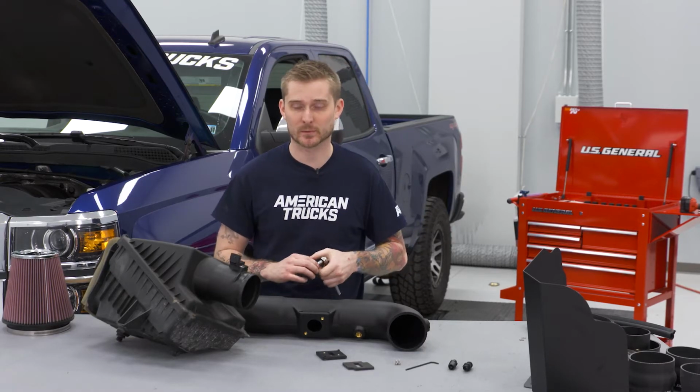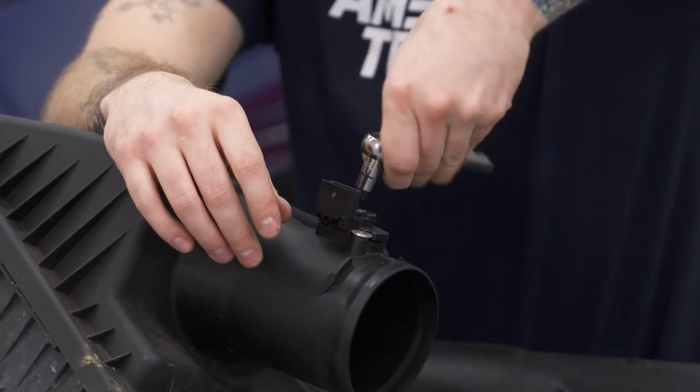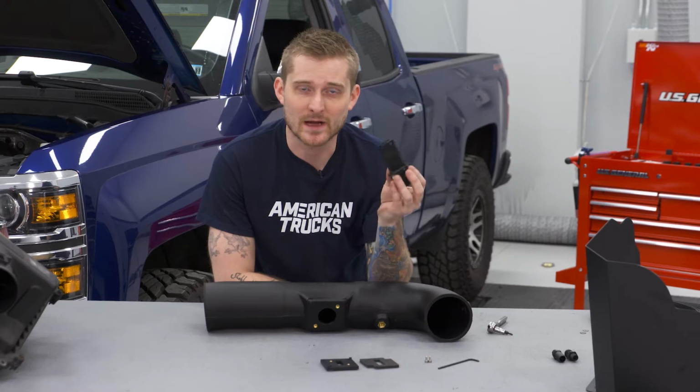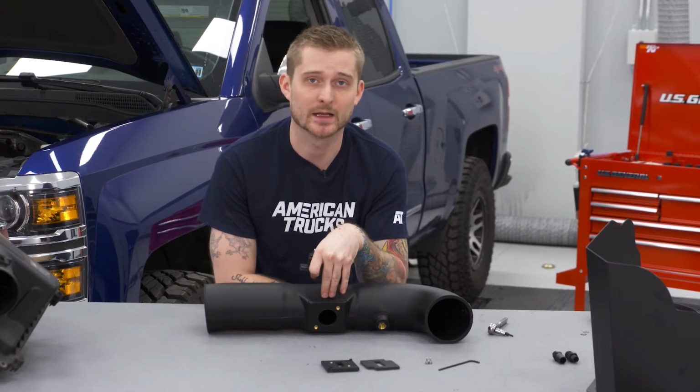All right, now that we've got our factory intake removed from our Silverado, we're gonna go ahead and swap over our MAF sensor. To pull the MAF sensor from the factory air box, you're gonna need a T15 Torx bit. All right, with your factory MAF sensor removed, you're gonna go ahead and install it into your new K&N intake